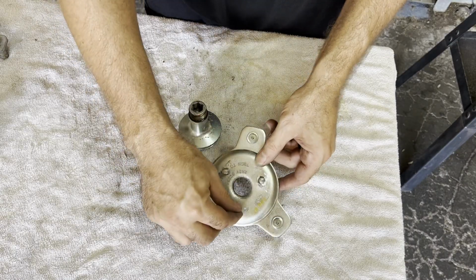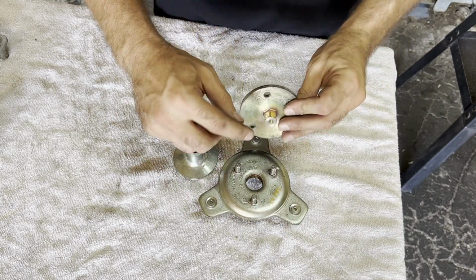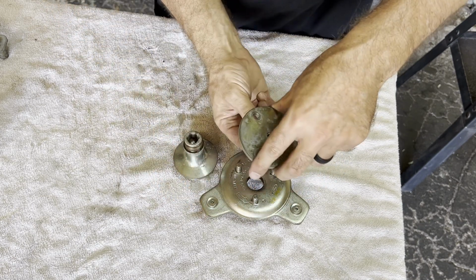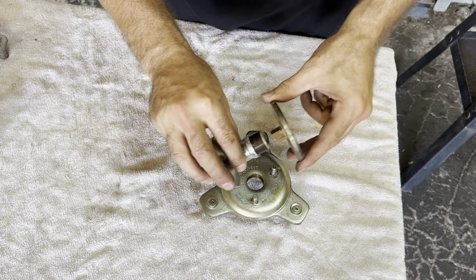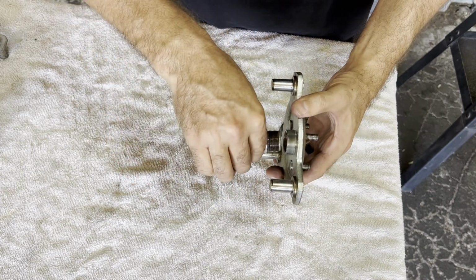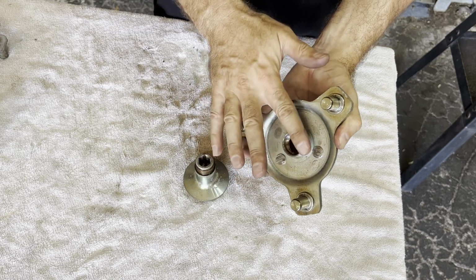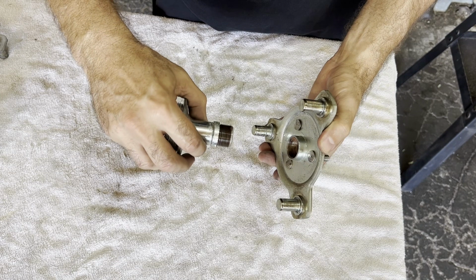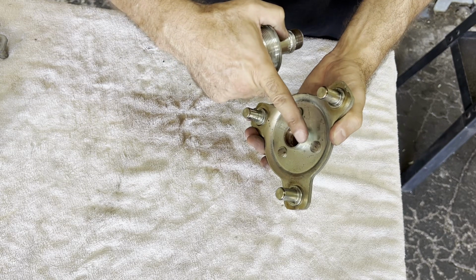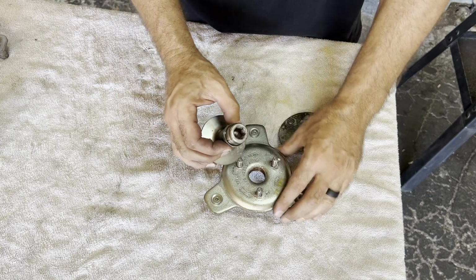Okay, now with our studs in here, we need to clock these two so that this locking plate will work. And what do I mean by that? Well, when you line up those studs with those 3 holes, this hex piece is in a fixed location. It can't turn to a different position, so it needs to line up perfectly to slip into that. And the way we do that is we spin this all the way down, test the fitment, and if it needs to change, we can file some material off of here with a hand file. And when you do that, you're gonna allow this to engage slightly deeper. And as it goes slightly more in, it's gonna turn a little further. So as you file just small amounts off at a time, it'll change how this ends up and it'll adjust how these two are clocked within each other.